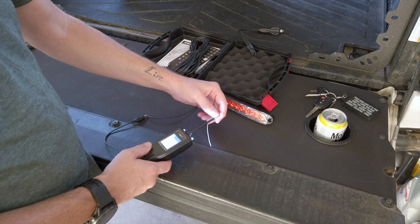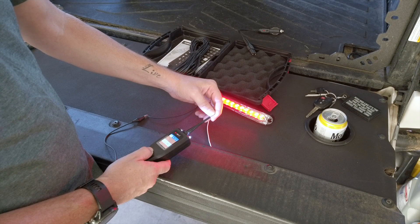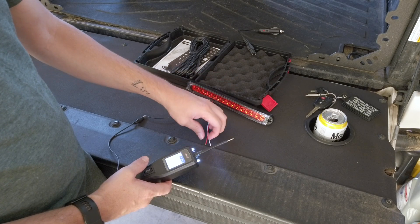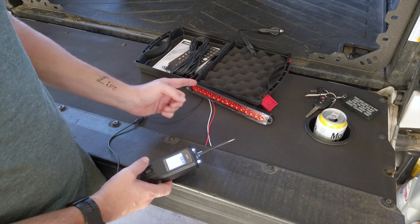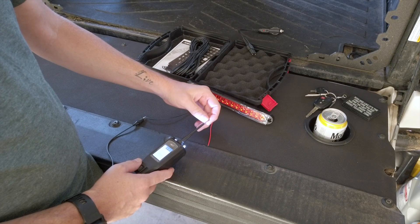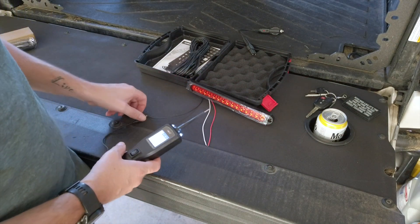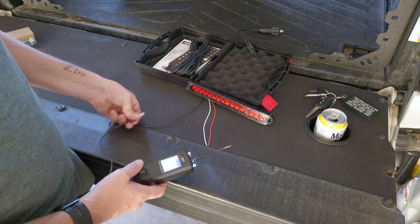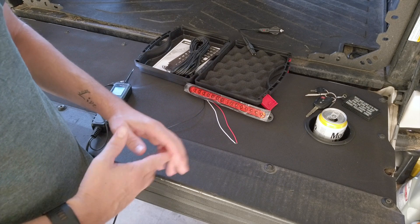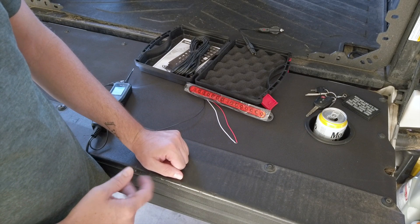Then we can check the other wire. It kind of goes back and forth and fades. So it gives me two different choices on what I want to do with this light as far as how it behaves when I hit the brakes. I don't think the tracking back and forth is legal, but my third brake light on the truck has that style where it kind of flashes — that gets people's attention a lot better. So now I know I can connect up my ground, connect up my white wire, and I'm done. I don't even have to use that red wire — I can cap it off, tape it off so nothing gets onto it, and good to go.